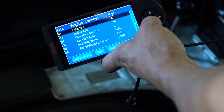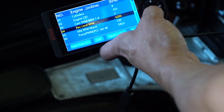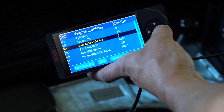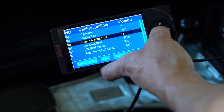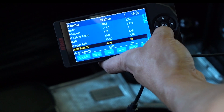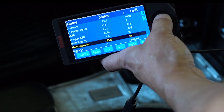For the initial setup, this is a 355 cubic inch engine with a mild cam, and the engine builder says it can handle 6200 RPM no problem. With the initial setting on cam 2, I can see the AFR Learn is pulling out a lot of fuel, so I'm going to switch up to cam 3 and see how it does. It'll stumble a little right when I switch because it's changing to a different volumetric efficiency table, but that goes away quickly. The fuel is correcting itself and adding a little more. I'm okay with it being minus 20-something percent at idle — it's the higher loads that are more critical for cam selection.